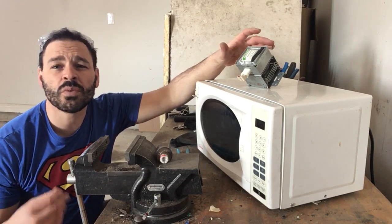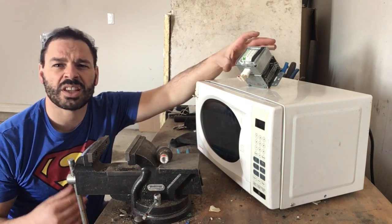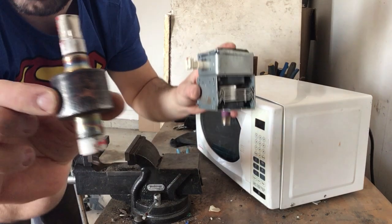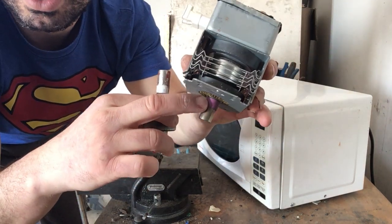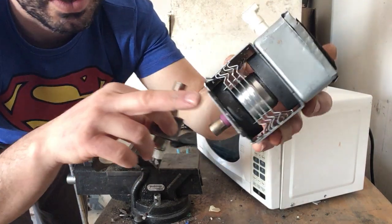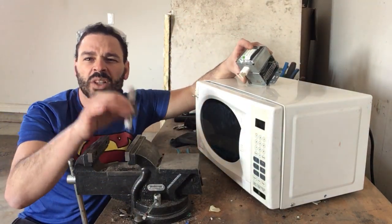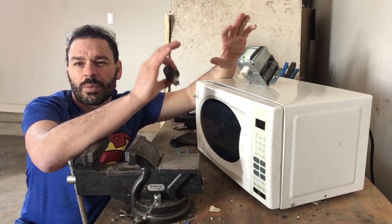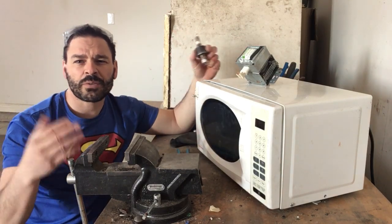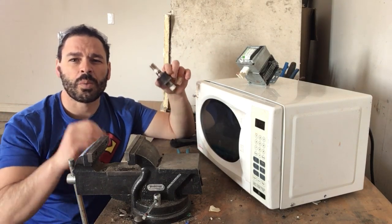They also have two very powerful magnets that you can use while scrapping. However, they can be very dangerous if not handled properly. The inner core has two ceramic strips — this one has two white ones, this one has two purple ones — and inside those ceramic strips they can have beryllium. Not all microwave magnetrons have beryllium, but when you're scrapping you cannot tell the difference. So it's better to treat all of them with the same caution.